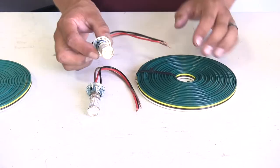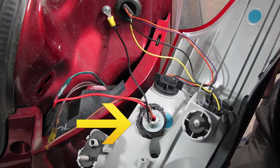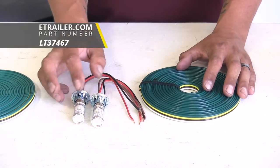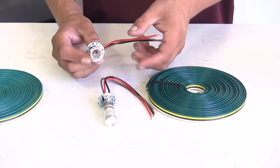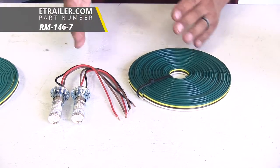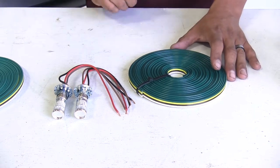Keep in mind that we are going to have to drill a hole into the taillight housing in order to get the bulb in place. Because of that, we're going to have to make sure that we seal it up really well, typically using some silicone or other kind of sealant. I suggest getting the LED style because then we're not going to have to worry about changing the bulbs ever. With our bulb and socket kits you will need to pick up the plug as well as the umbilical that's going to go between our CR-V and our motorhome to get all the lights functioning properly.